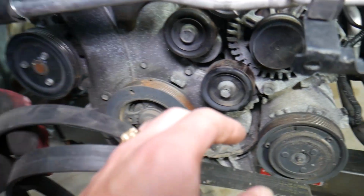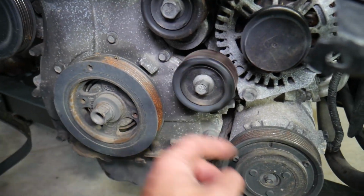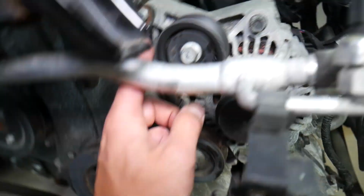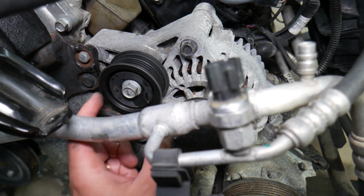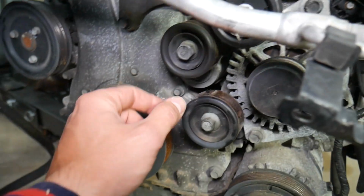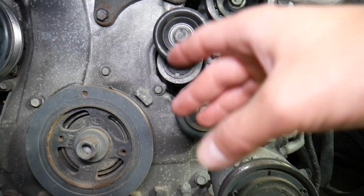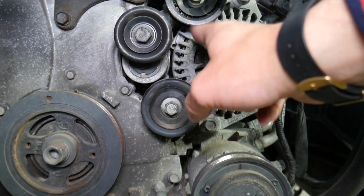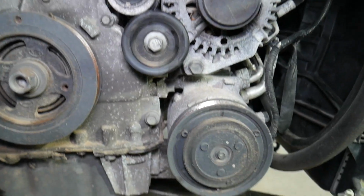I'll recommend at that point for some of you to even inspect or replace the idle pulleys. This one is good, this one is getting bad. You can see it's getting loose and developing noise. The tensioner pulley is good, but sometimes they fail too. So if you're doing the serpentine belt, in my opinion the best thing to do is go with a belt, two idle pulleys and a tensioner pulley. And if you want to see the whole kit, we'll put the link in the description of the video below.